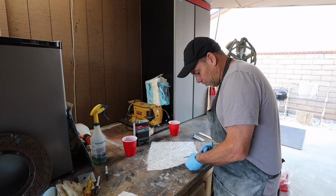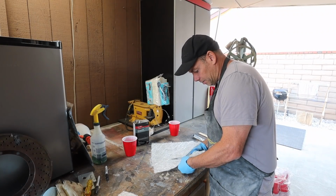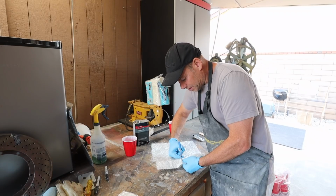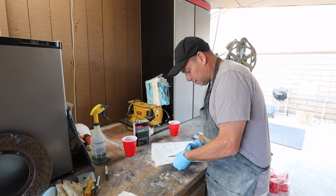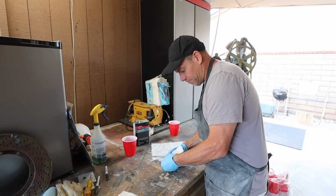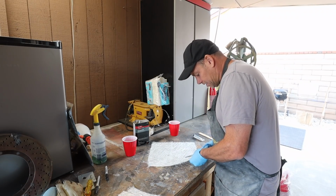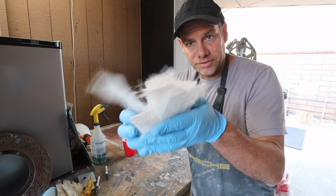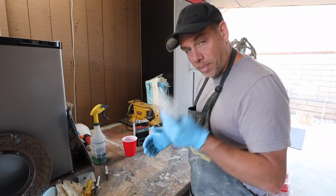Because I'm doing a bumper, I want this thing to have a lot of layers to it. I want this thing to be really solid by the time I take those straps off on the other side, because there's a whole part B to this once the fiberglass has dried at least well enough on the other side. So I have here a pile of strips that I can use. I will put those over by the part now.